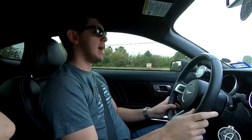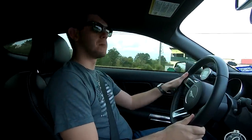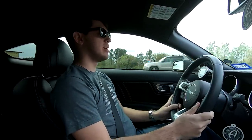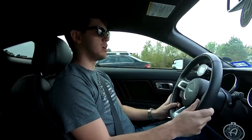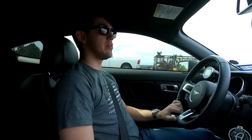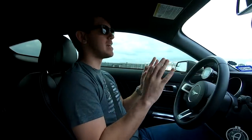They were tuned by VMP and made around 508 wheel horsepower on E85. When I watched that and thought — wait, you can do basic bolt-ons to a Mustang and make over 500 wheel horsepower — that really opened my eyes to the potential these cars have. You don't have to change injectors or do a full fuel system. Just slap an intake, headers, and a tune.